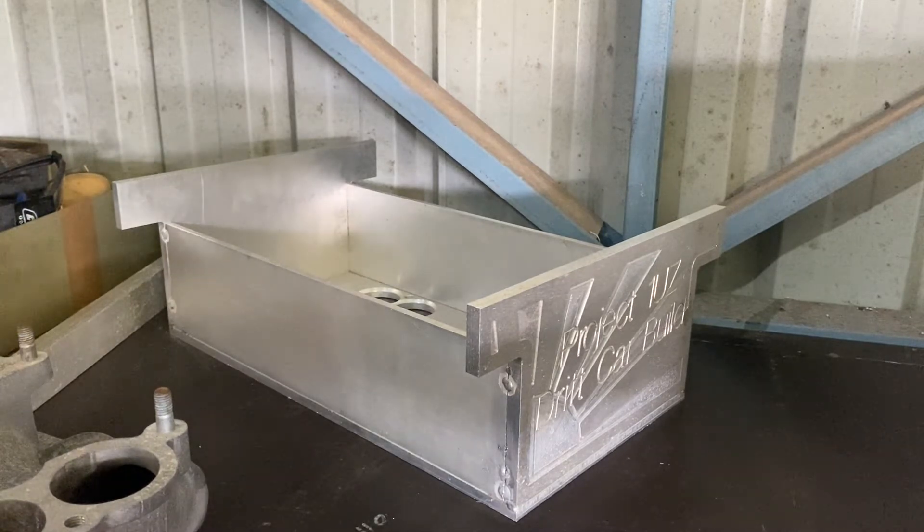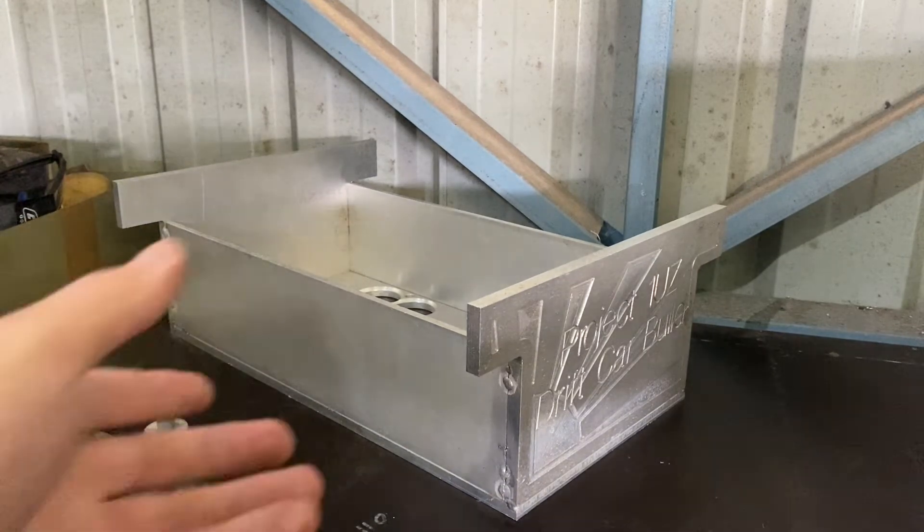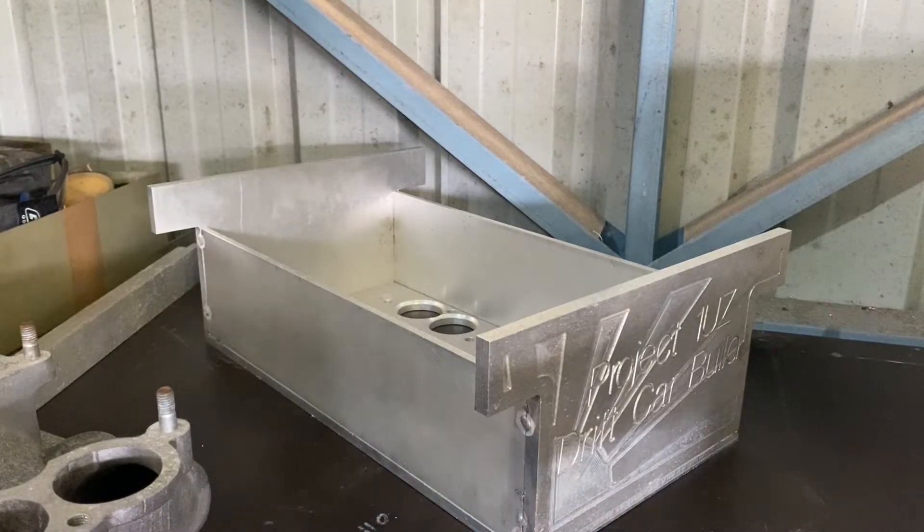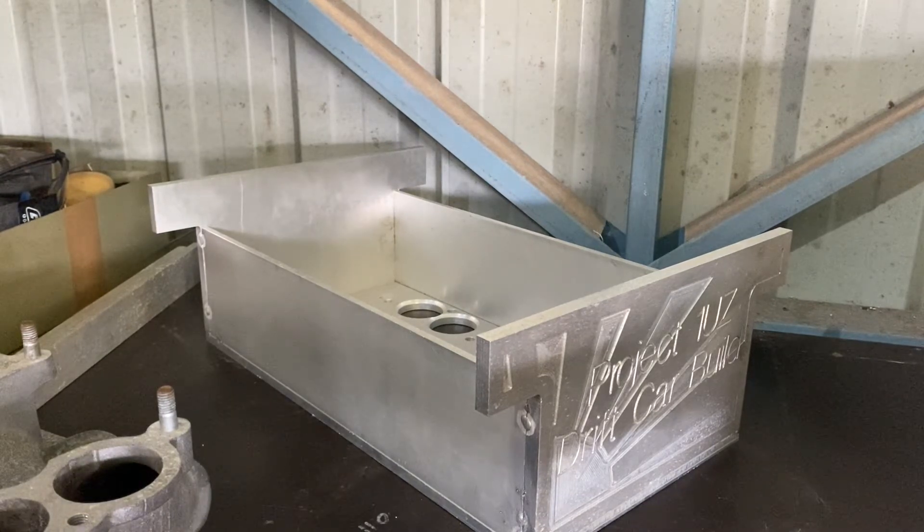Keen-eyed viewers will take note of this over here — basically I'm putting this into the uncompleted project pile. This was going to be the 100-millimeter intercooled M90 manifold for the car. With where the build currently sits, I don't think there's much to be gained by continuing with that project. In theory, that 100-millimeter intercooler could get temps down to ambient, but I'm guessing we'd probably only pick up maybe 20 horsepower — and that doesn't seem worth it. So the next logical step is a bigger supercharger.